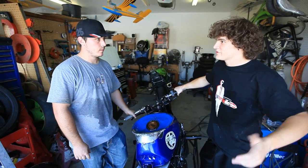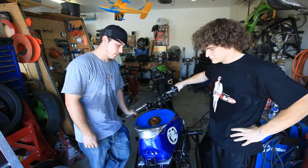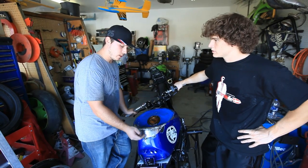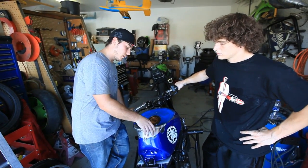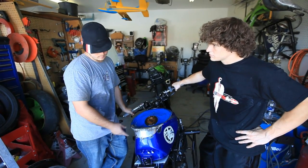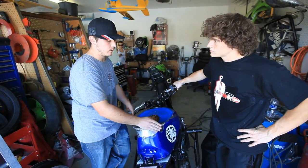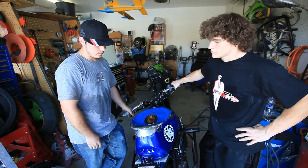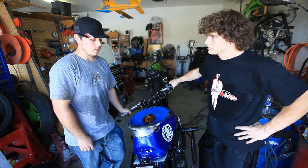Alright, so Chris is done. You want to sort of maybe recap the steps you did to finish this? I only had to make one center brace underneath here. Just one to get my height set, kind of the shape of it, and then cut these two pieces of plate out, bent them up. Had to notch these, cut them with a grinder one at a time, bend each one over, kind of hammer it into shape, weld it all together, and with a little bit of Bondo and paint, you should almost not be able to tell there's something welded on there.